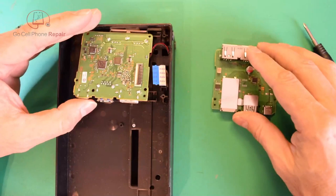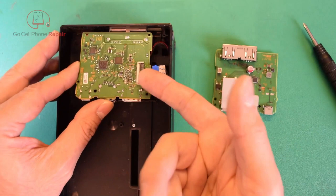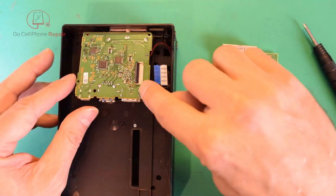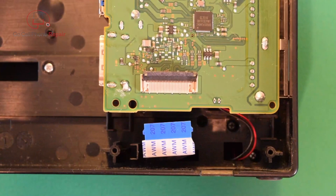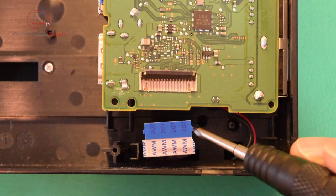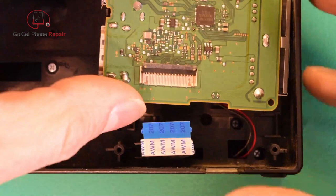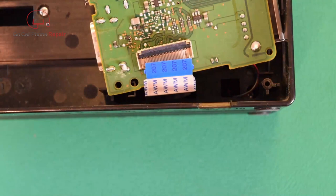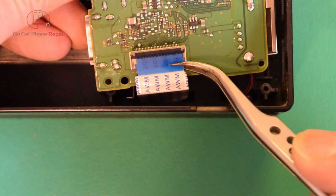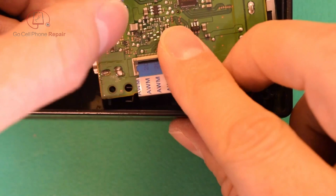Then grab the new board. Go ahead and plug this back in — snap that into place. The tricky part is getting this to go back into this section because it doesn't slide in; it has to go in with the front end first and clear some clips. There are some little plastic pieces on either side and these go behind this part of the cable, so getting this plugged in can be tricky — just be patient. What we have to do is set that front end in first and then get it to lay down flat. Very carefully get that in, make sure it's all the way inside, and flip that down on top of it.